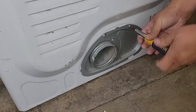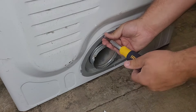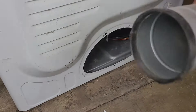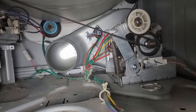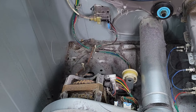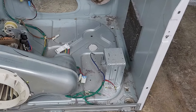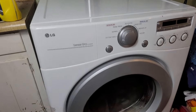Taking apart the dryer for cleaning is also a good idea. Every dryer is different on disassembly, but Samsungs usually have the dryer vent that can be taken off entirely with the rear access panel, which lets you get in super easily. This is one we cleaned out before the video for a customer we're getting ready to sell it to, but most dryers are going to look horrific prior to cleaning. Even if you have to do a full disassembly, it's worth it — you want to make sure your dryer is cleaned at least every year on the inside.